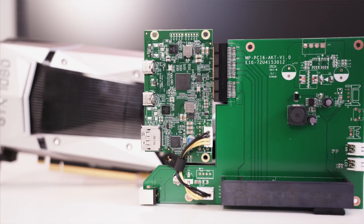My Founders Edition 1080s both have a single eight-pin connector, so I did testing with that. Unfortunately, with both of those external solutions, the computer immediately restarted as soon as I jumped into a game. It worked in the operating system with no issues, but it restarted once I jumped into a game. However, under further testing I used my EVGA 850 80-plus Gold power supply, just one of the eight pins into the video card, and it worked perfectly fine. I was able to play all the games I wanted to with absolutely no issues — 150 frames plus. So I would maybe recommend an SFX power supply. A lot of people take the Akitio Thunder 3, take out the PCB, make their own custom case, and put the power supply in that custom case as well. But yes, it is possible to stick a different video card inside of the Akitio Thunder 3 as long as it fits — just remember it needs external power.